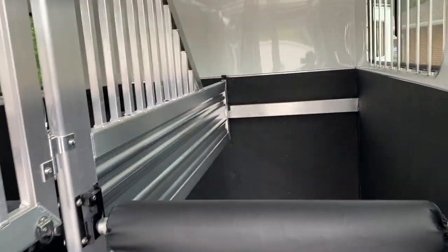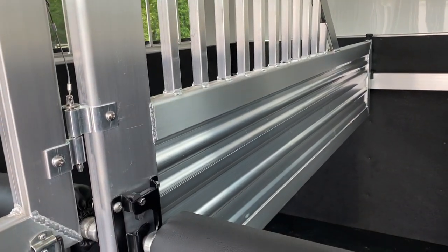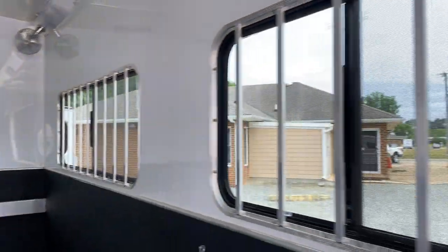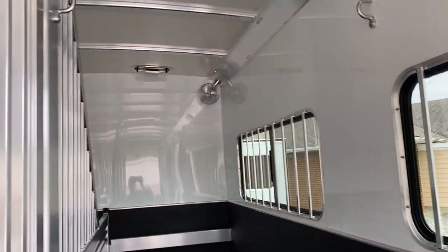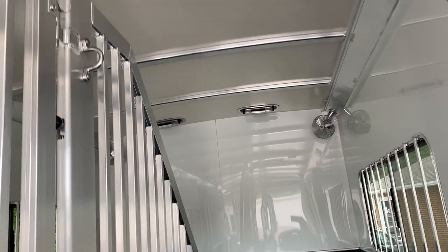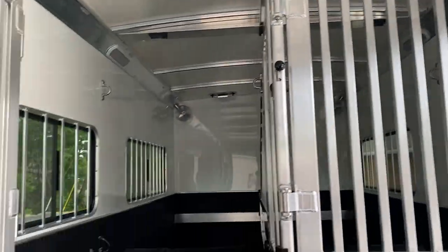On the front end of this trailer we've done a standard horse stall — two horses up front, rear-facing, with a bar-style shoulder divider, partial body divider, and a fan back there. I put roof vents at the butt of the horses so it covers most of the horse's body, and then another roof vent at their head. We've got swing gates at these horses' heads so you can isolate those straight-load rear-facing horses.